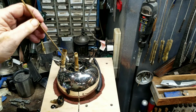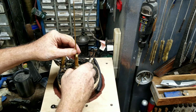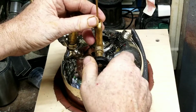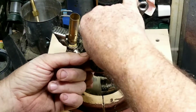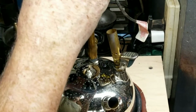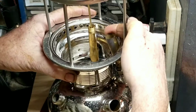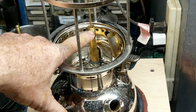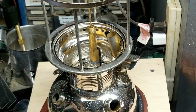This is the worst part of taking one of these valves apart, is trying to get these valves to line back up with that eccentric block. Well, that was simple enough. That's doing the trick. Set this frame back on. Line your hole up for your generator. Be careful not to hit that tip. It's got another slot for the rapid heater, preheater.